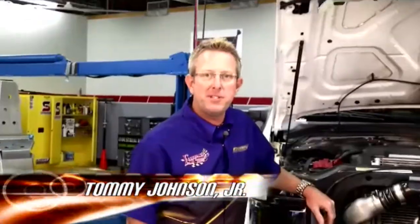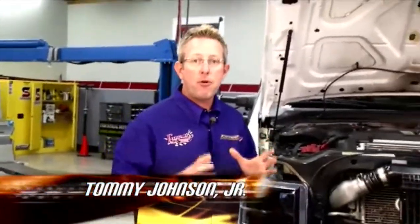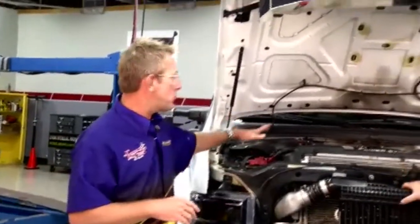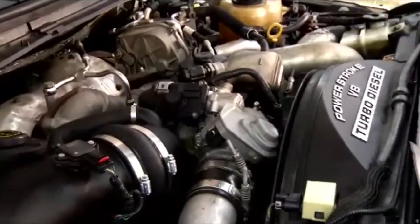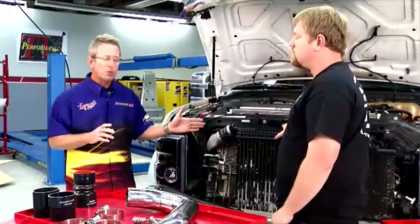Welcome back to Performance TV. A lot of times when you make performance enhancements to a vehicle, you run into problems you didn't expect. This big Power Stroke Ford diesel has a new cold air intake, a reprogrammed computer, and exhaust system. Problem is, now we're running into high exhaust temperatures under load. The intercooler can't keep up.